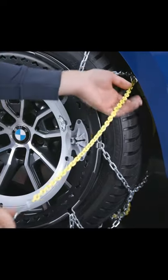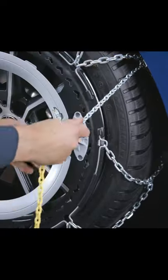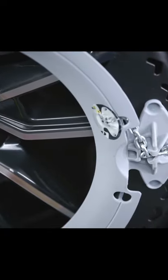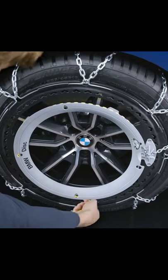To prevent damage to the vehicle, it is only permitted for the vehicle to be moved if the yellow-colored part of the tensioning chain has been fully pulled outwards. Hook the tensioning chain in the locking slot and make sure that the hooked-in chain link is located on the base of the slot. Wind the tensioning chain anti-clockwise onto the gray storage ring.